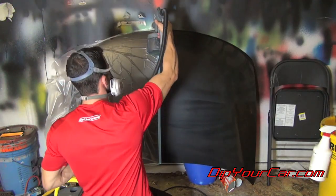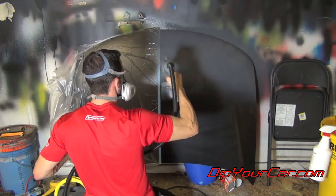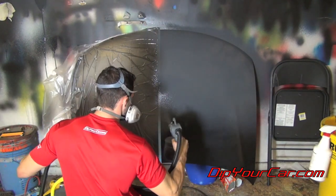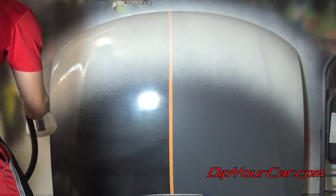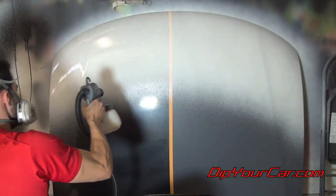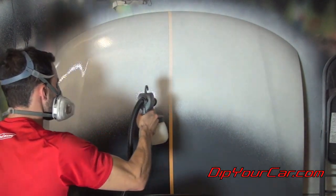What I'm going to do today is walk you through a project. I've got a car hood, and on half of the hood we've just cleaned it — it's just regular paint and regular clear coat. On the other half of the hood, I put down two layers of gunmetal Rubber Dip S. We picked gunmetal because light gray is used in the automotive painting industry for primers and base coats all the time, and gunmetal gray covers extremely well — two coats covers like a blanket, can't see anything underneath it. So we're going to split that hood in half and put a full coat of white Rubber Dip S over the entire hood so you can see the behavioral differences between the side with no gunmetal underneath and the side that does have a gunmetal base coat.